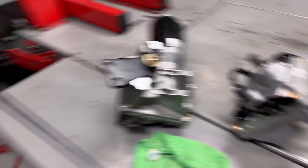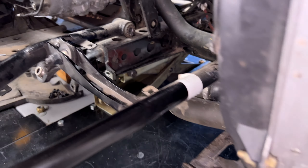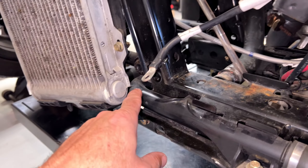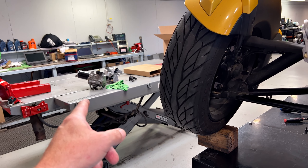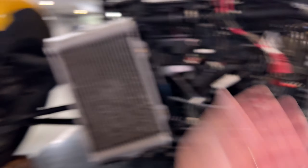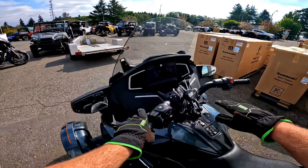It's got a long ways to go to come off there. That thing did not want to come out — I did just what it says: loosen that lower A-arm so it can all swing out, and still the radiator gets in the way, so I had to dislodge that and flex it forward. This is the curb scooper pipe that gets broke. Anyway, the pitman arm is my biggest thing, and I'll see if it's possible to put it back on with it still in the bike.